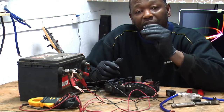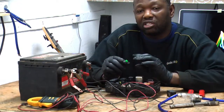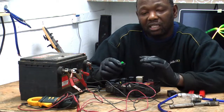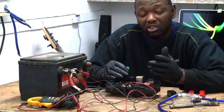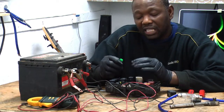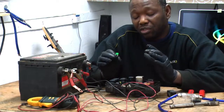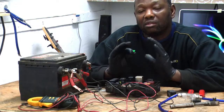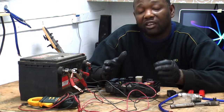The way you check it: go to the source of what the fuse controls and try to disconnect it. For example, if it's your brake lights, try disconnecting each brake light one by one. When you take out all the brake lights and go back and plug the fuse — if the fuse didn't burn, then you know there is a short in one of the lights. You go light to light until the fuse stops burning. Same thing for a radio: disconnect the radio, put back the fuse, and see if it burns. If it doesn't burn, your problem is the radio. Every component that the fuse controls — that's where you go and check, one by one. It takes time; that's what we call electrical troubleshooting. Other people don't like to do it because it's time-consuming, and you'll pay the garage a lot of money to fix it.